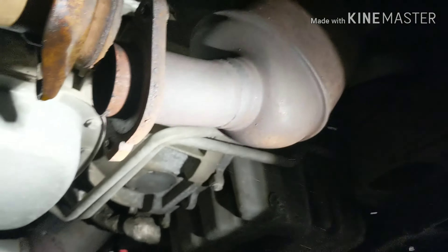2005 Cadillac CTS. I'm gonna explain how to take the catalytic converter off — this is the new one we're gonna put on. First, forget about removing the O2 sensor while the cat is on the car. Do not remove the O2 sensor.